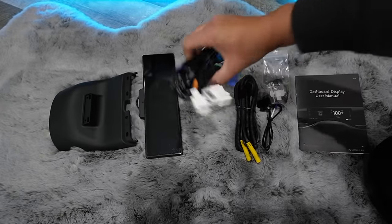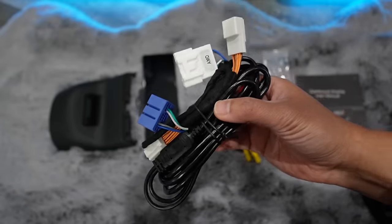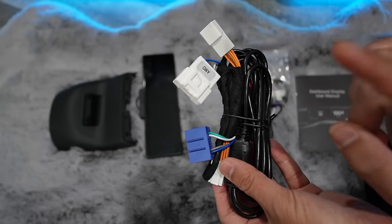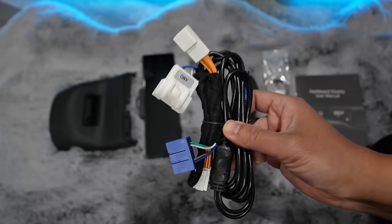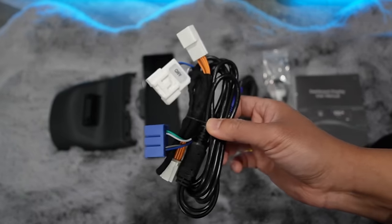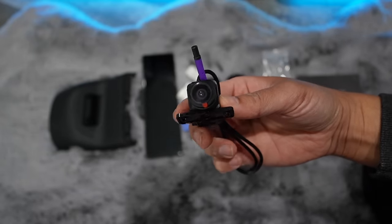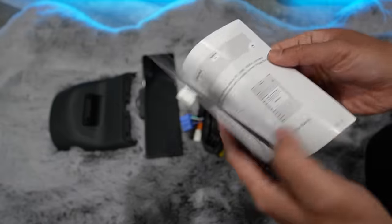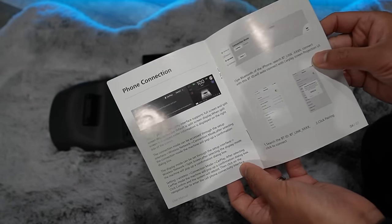This is the wire harness for the AMD car, but today I'll be installing it in my 2021 Tesla Model 3 with Intel processor. My car has the port on the passenger side panel, so I can still use the AMD version. If you have a 2021 or newer car, your car should have this port — make sure you check first before ordering. On the product page there should be an option to choose between Intel and AMD. The front forward camera installs underneath the front bumper where the vent is to cool down the battery. The instruction manual is really clear — the best English instructions I've seen reviewing these products.